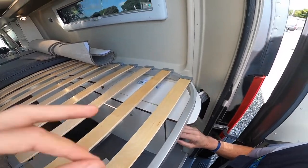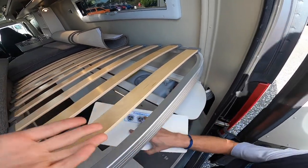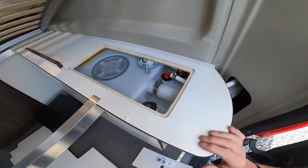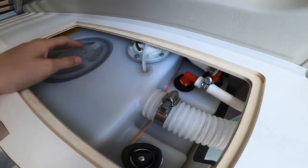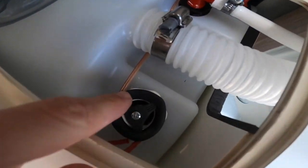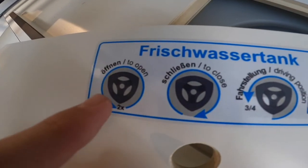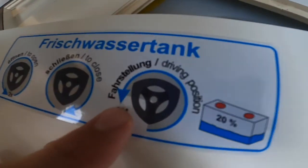At the back, your fresh water filler's on the other side of the vehicle. If you lift the mattress and the bed base, there's a little cover here which you lift off, and this is your fresh water tank. To drain, you'd use this little winder here, and it tells you on here, so two times is open, three quarter position